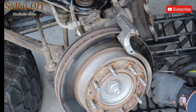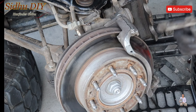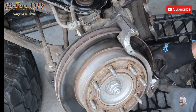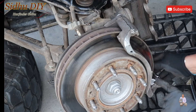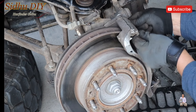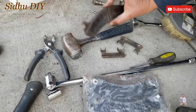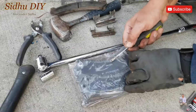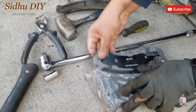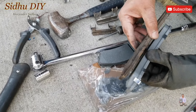If you're buying brake pads that come with new retainer clips, definitely change them. Some companies sell the brake pads only, and sell the clips separately. Put the new clip on top and press it in, then the top one goes on. These are the new brake pads compared to the old ones — the old ones are totally gone.